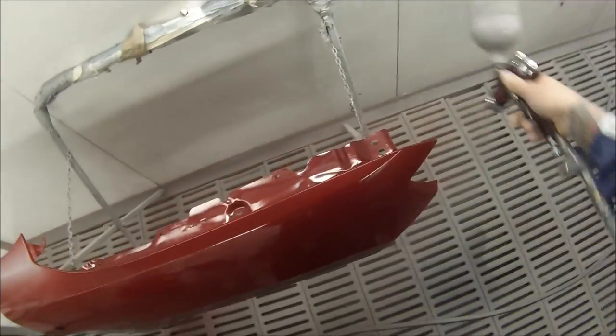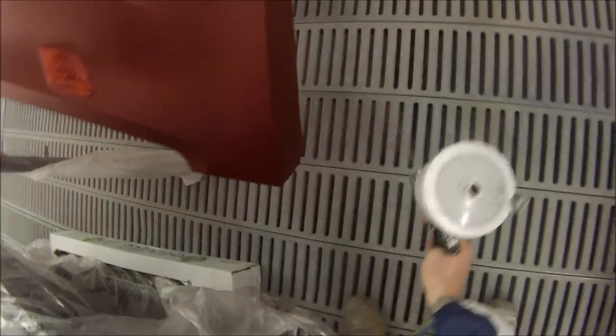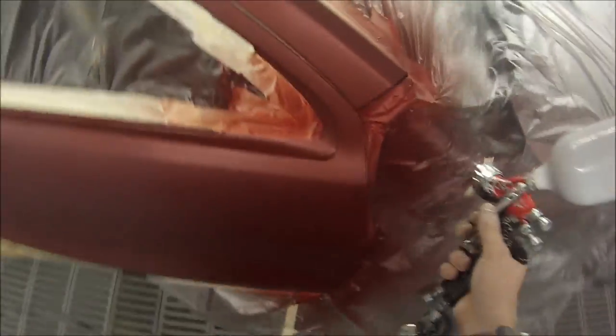Here we go — start off with our first coat of colour. What I'm putting on here is actually just a ground coat, because reds don't really cover very well. I ended up mixing up about 200–220 mils of the top coat colour, and then I found some red that was sitting on the bench — just about a hundred or so mils left over from the last job. So I did it with red base coat and I'm just putting that down first to aid with the coverage so I'm not going to use too much of the top coat. Just putting it on nice and wet just to get the coverage. Reds are pretty well known not to cover up very well over any little spots where you've cut through with your sanding. I'm also blending up that pillar for the colour too.